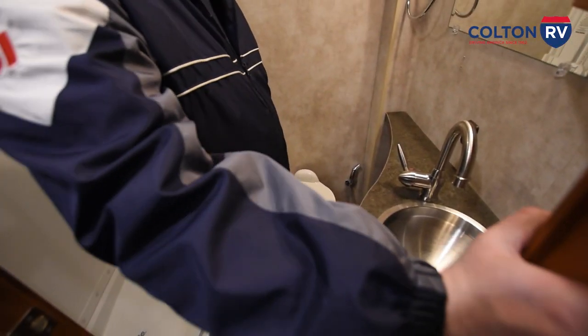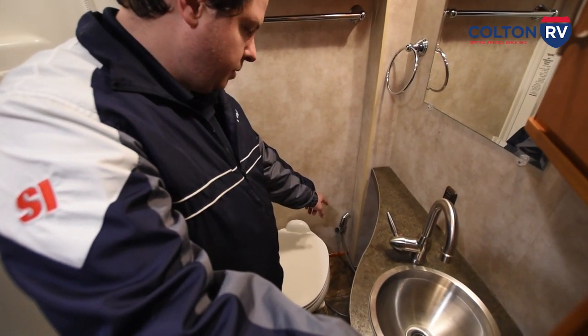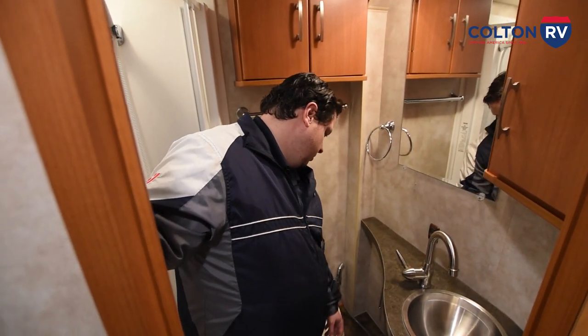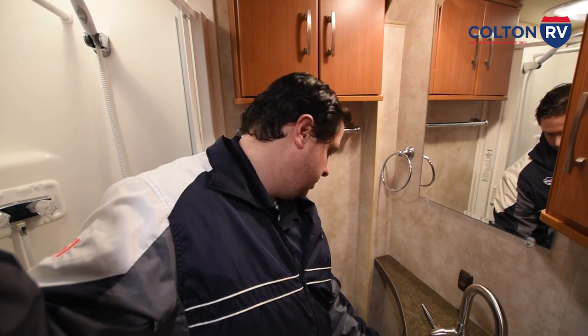The toilet is easy to use — there's a pedal on the right side. Good idea to fill the bowl with water: if you slightly press that pedal just a little bit, the bowl will fill up with water. Even when you're done using the bathroom, you should leave a little bit of water on top of that toilet ball valve so the rubber ring on the outside doesn't dry rot. To keep a little water in there, you need to fill it above the waterline — hold down the pedal just slightly. When you want to dump everything, push the pedal to the floor. Same with the sprayer — there's a little button you push to use it, but you've got to be pushing on the pedal a little bit for the sprayer to work. If you're not hooked up to a water spigot, there's a switch right below the sink to turn your water pump on and off — it's a push push.